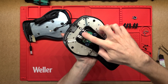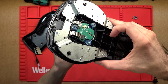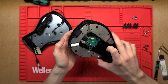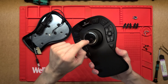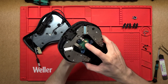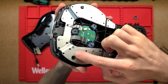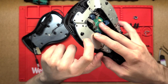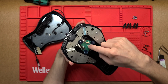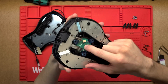On the other side, undoing those three screws from underneath the sticker releases the main mouse puck, which flaps around a little. It was inserted from the bottom because it has three feet that are wider than the opening, so to remove it we'll peel off this plastic top piece. Around the mechanism there's a piece of metal acting as a base for all the buttons, providing a solid surface to press against, with a thin ribbon cable connecting the button switches to the main board.